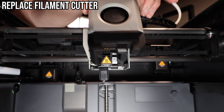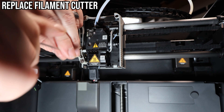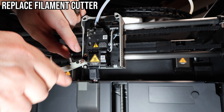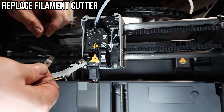To remove the filament cutter cover, you'll first have to pull away the extruder cover — it's held on with magnets so it's super easy. There's a single screw that prevents the lever from coming out all the way. You don't need to remove this screw, but back it out until the lever falls into a resting position. If it doesn't, or you have to push it a little bit, then the screw hasn't cleared the housing yet — I found out the hard way.